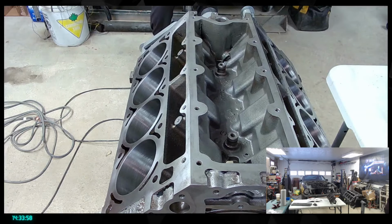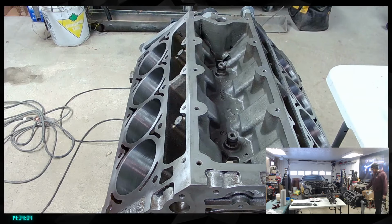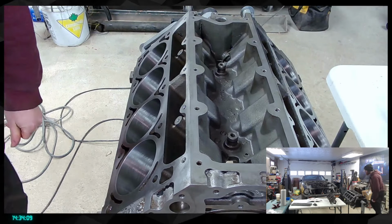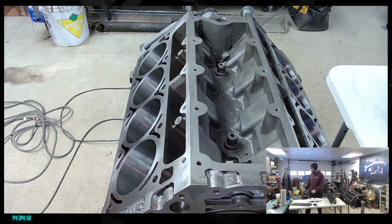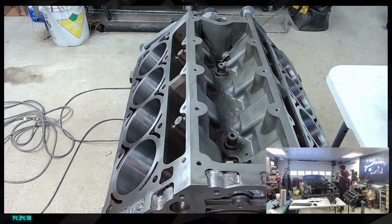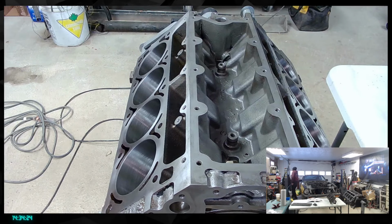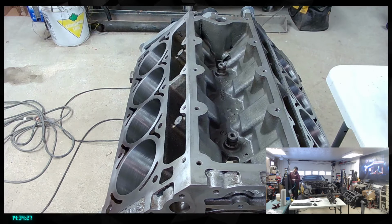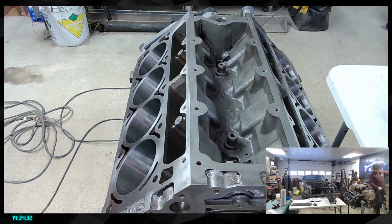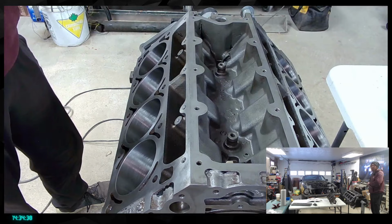One thing we can also do this afternoon is prepare the tools by cleaning them. It will be a good idea because we need to clean all the tools we're gonna use, to make sure we're not going to have some contamination. If you have some old residue on your sockets or your ratchet or anything, it could cause contamination of the bearing surface, which means damage. Usually it's not that it's gonna blow up straight away, just that in the long term it could reduce the life expectancy of that. So yeah.